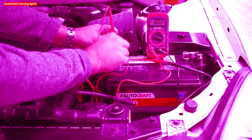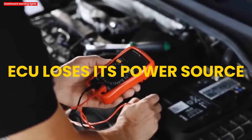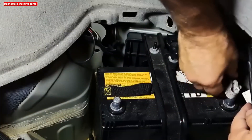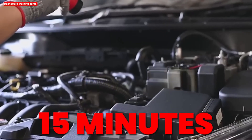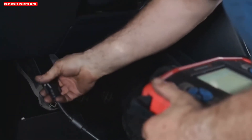Here's why it works. When you remove the battery's negative terminal, the ECU loses its power source. Any volatile memory is erased once the remaining charge drains. Experts suggest leaving the battery disconnected for about 15 to 30 minutes to ensure a full reset. This time window is generally enough to let all residual energy in the ECU discharge. Some sources cite 15 minutes as sufficient on most cars, while others recommend up to 30 minutes on newer models with larger memory capacitors. Either way, a quarter hour is a good rule of thumb.